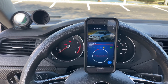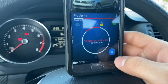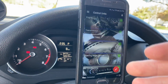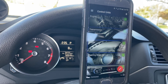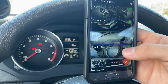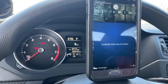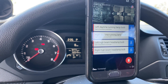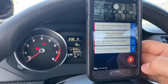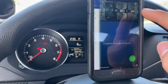After a few minutes of scanning, it's gonna say how many fault units or problems you have. It says we have two — let's see what they are. Green is good: engine is good, transmission is good, central electronics has no faults. The only fault is a daytime running light lamp, because there's aftermarket lights installed — so we're gonna clear that. There are no faults now.